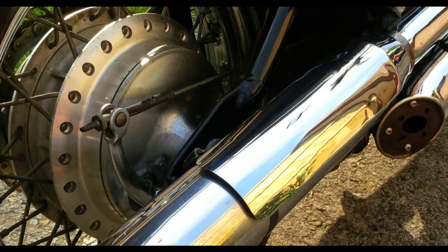The only exception is the Drifter, the VN 800 CNE. Those have disc brakes. It is obvious which one has the more braking performance, but the drums aren't too bad if they are cleaned and adjusted properly, and if you use decent brake shoes.